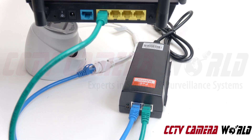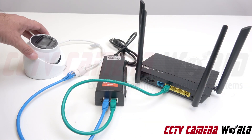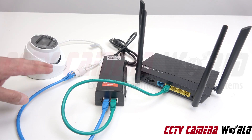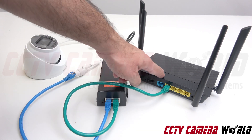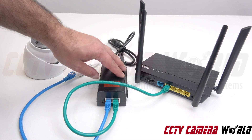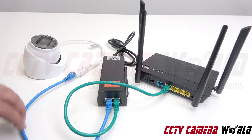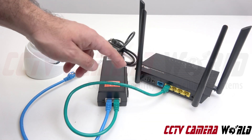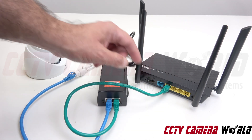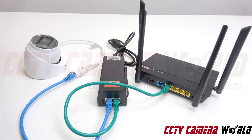And that's pretty much it. Now I've got a single PoE security camera or IP camera powered over PoE with a PoE injector that's plugged into 110 power and also to my router. It basically combines power and data through the blue cable, through the power plus data port, which is PoE, to the camera. Now I can access this camera through my router using either another computer connected to the yellow ports, or over a computer connected to the Wi-Fi. I can also pair the camera using my iPhone or Android phone as well.